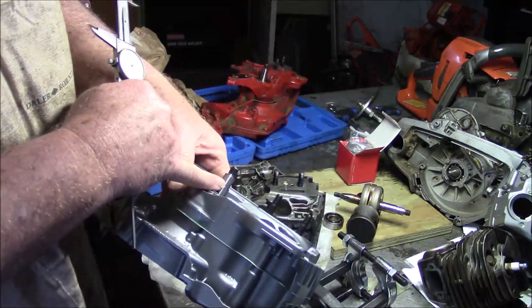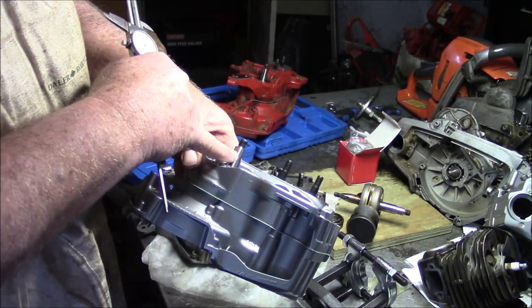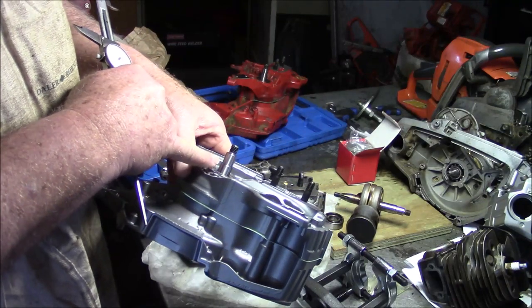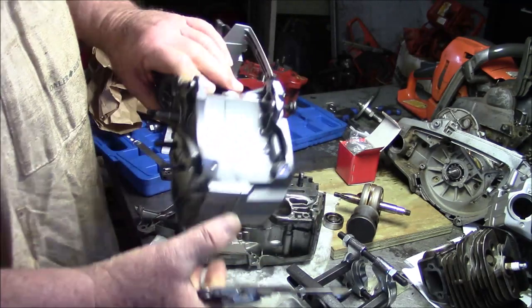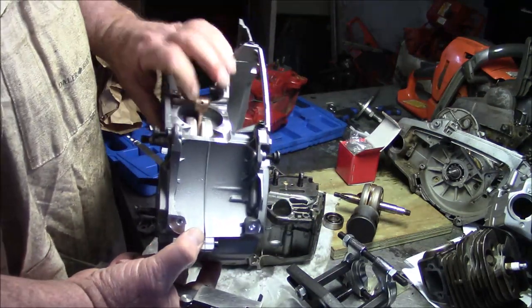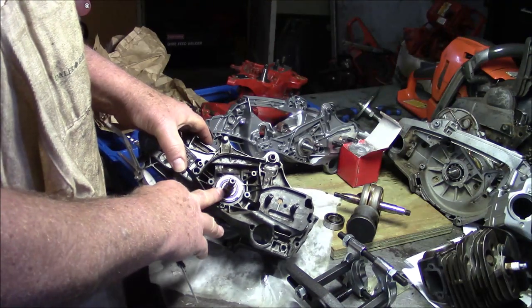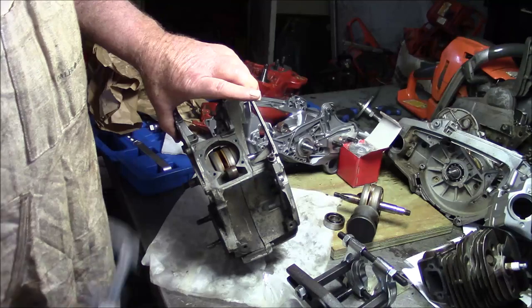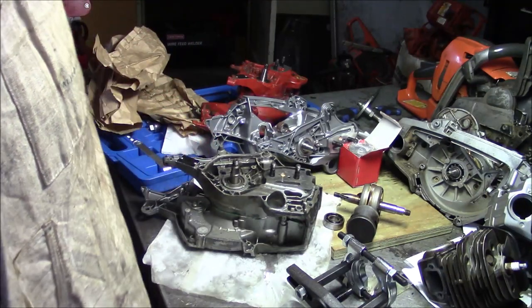So that's shorter on the 560 and the 555. The 555 has this crank with no stuffers. The 560 has a shorter stub with stuffers. See the stuffers on the inside? This crank here is unique to the 562. The 562 has got the stuffers, and that goofy one for down under doesn't.